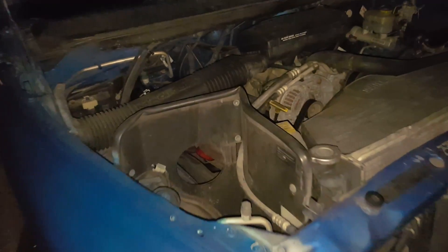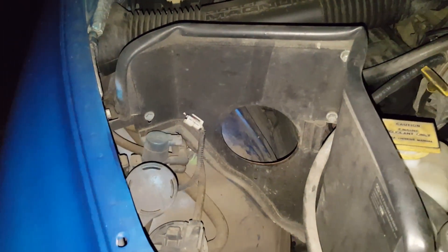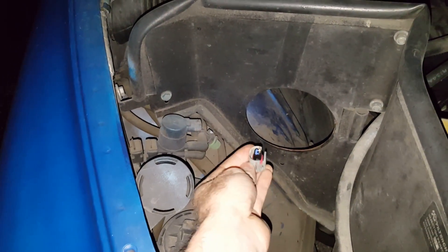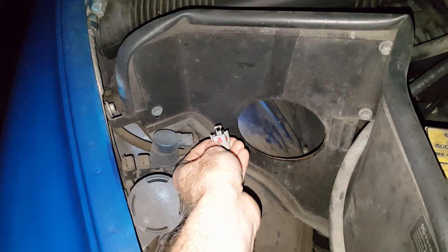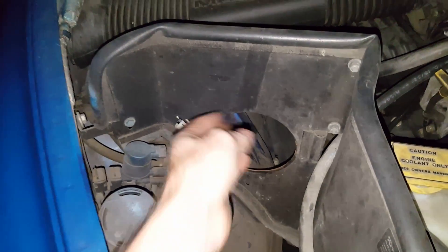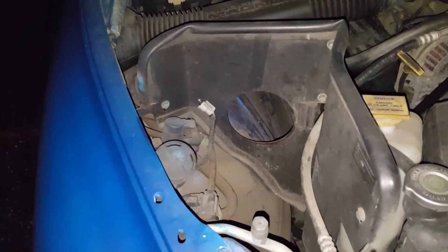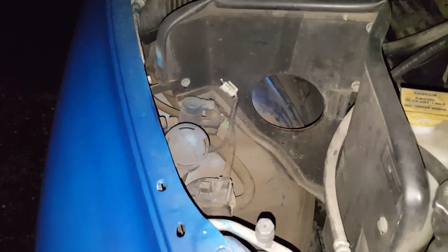What I did was I left everything else in, so technically it's still all somewhat sealed up. I was taking this connector and putting a 100 ohm resistor in there — this is a quarter watt resistor, but the wattage doesn't matter, you could have even an eighth watt, because it's not really doing anything there. That triggers it to say, hey, I'm working correctly and there's no problem with me.